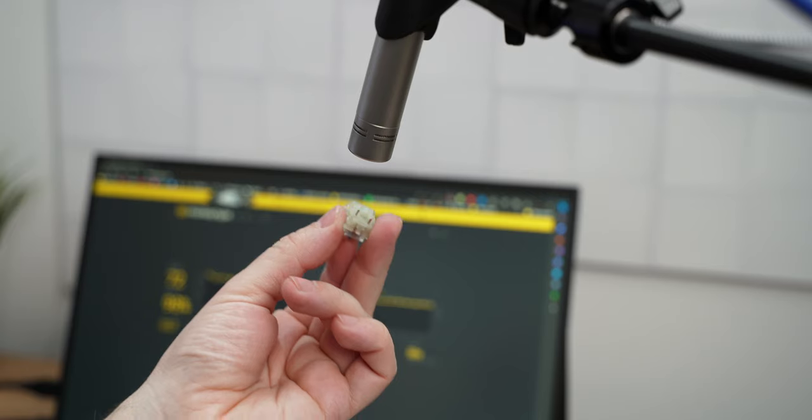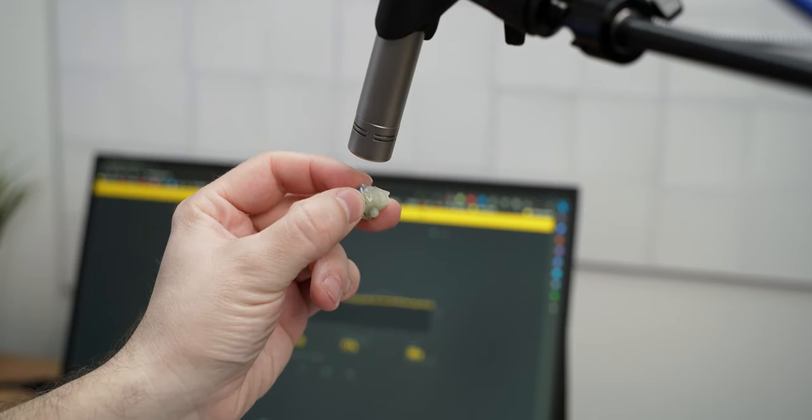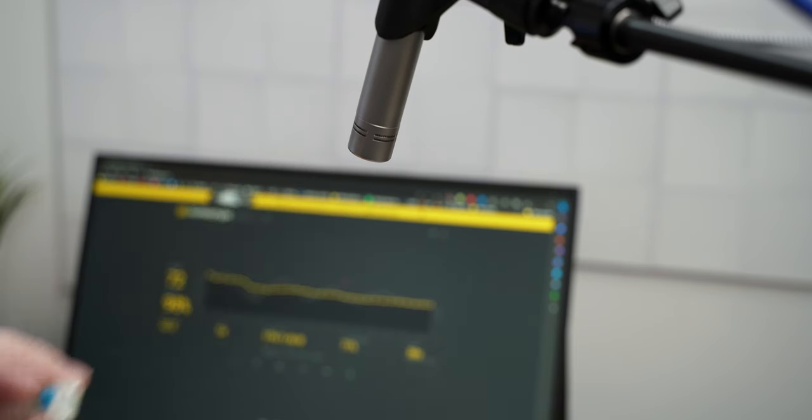So you can hear that the sound is pretty much okay for a clicky switch. The only thing that you can actually hear is the dreadful pingy noise, and this does not come at all from the keyboard itself. This is specifically narrowed down to a switch spring. I don't know if you can hear how it pings, but it does. Not as some switches do, but the noise is there, and if and when you start typing louder and faster, the noise intensifies.